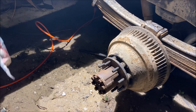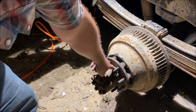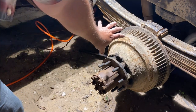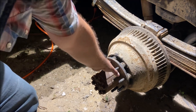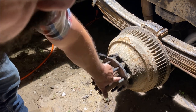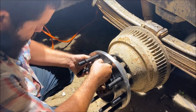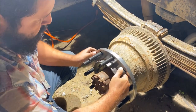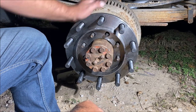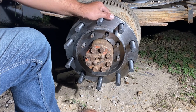We looked at that 4.56-inch double-lip hub earlier. First thing to do: put the adapter on and make sure it seats itself and isn't loose up and down. You might want to wire brush it clean first — I lightly sandblasted it earlier. These adapters were cut specifically for these hubs at 4.56 inches so they ride on the hubs correctly.